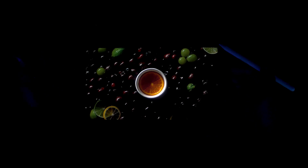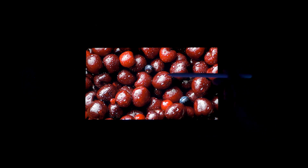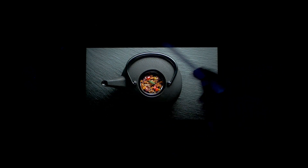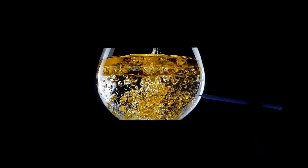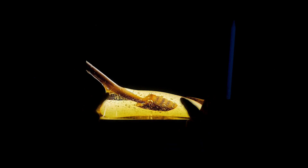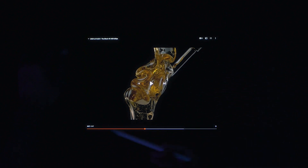I've turned down the sound to avoid copyright issues. This is an LG video promoting their OLED panels — the idea is very bright whites with very dark blacks, which is exactly where we see the blooming effect. Watching normal HDR video though, honestly, I watched a whole bunch of Dolby Vision HDR content and I can barely see it. Yes, you can see slight blooming where the contrast is very high, but when your focus is on the gorgeous video content, you can't really see it. However, if you look at the UI against the black background, you can see that blooming effect.